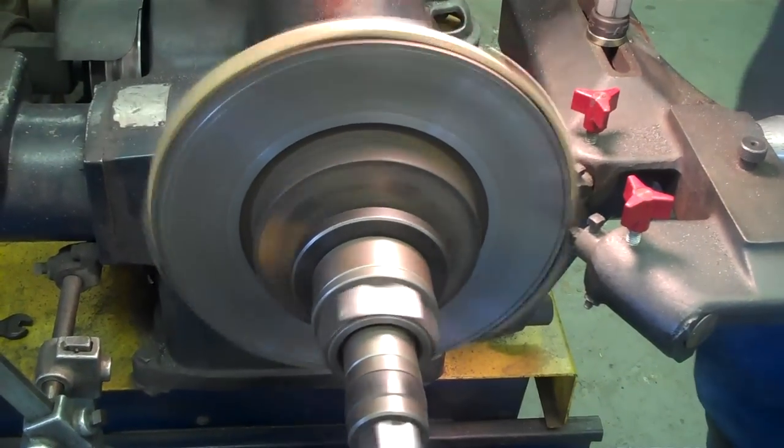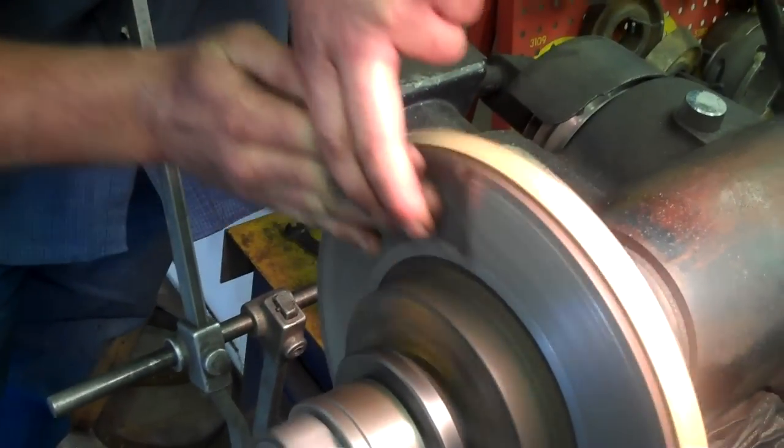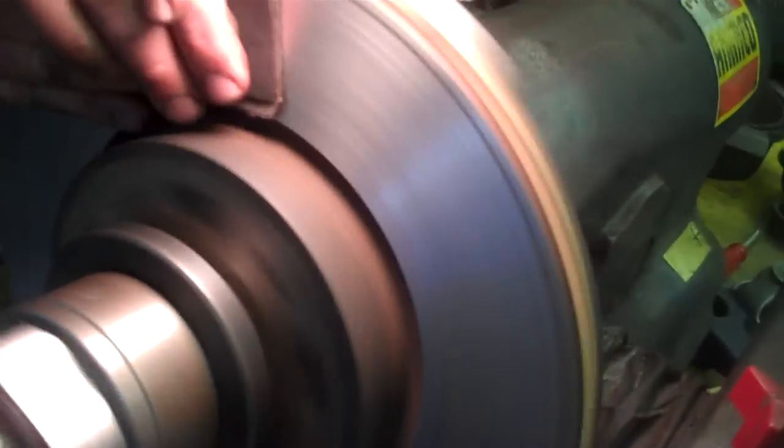Since we're good, put it on stop, move this to the neutral position, back this all the way off, and come over to this side for the emery cloth. You can see it changing the pattern. Go both sides. What that does is create a non-directional criss-cross finish — you can see it going this way and that way, a criss-cross pattern, nice and smooth. This other side I'd have to do one more cut to clean it up completely.